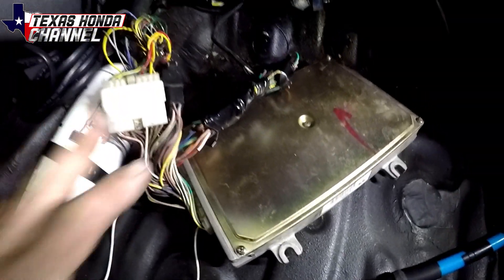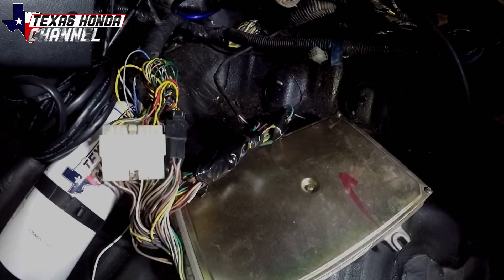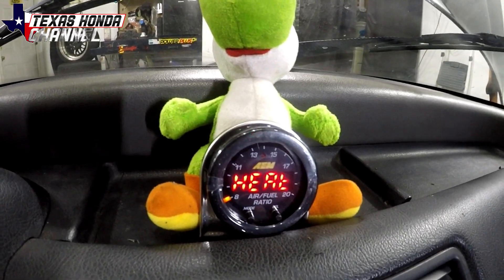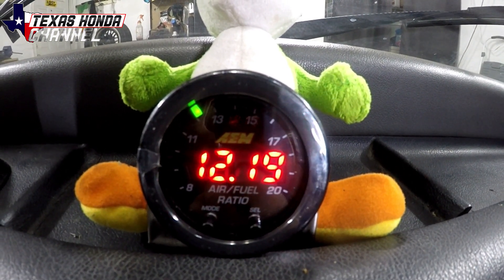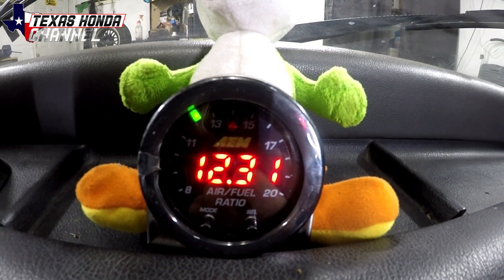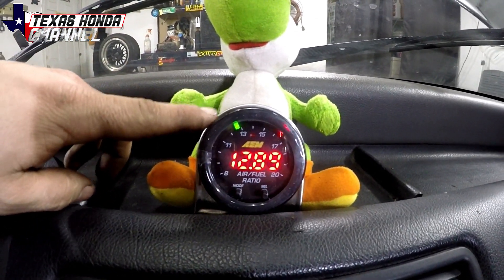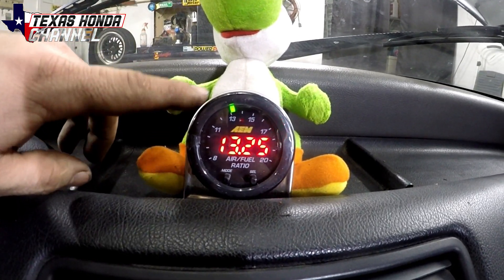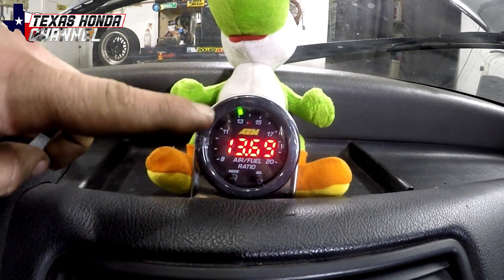I got all that connected to the computer how it should be. All the wires are kind of tucked up. I'm going to zip tie all these together and shove them up under the dash and put the computer back up. So it's turned on — we're going to let it warm up and see what it says. On cold starts I do run rich. As you can see, that's a 12.3, 12.4. I do have an exhaust leak before the O2 sensor, which will throw this into a leaner reading — make it say it's leaner than it is. So any air that gets in before the sensor is going to make this read different. Keep that in mind.